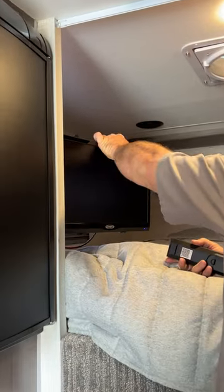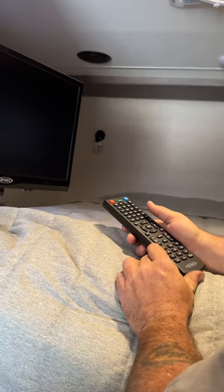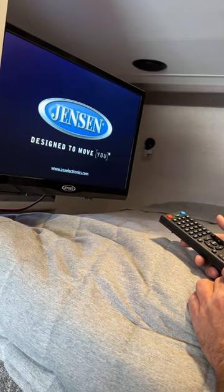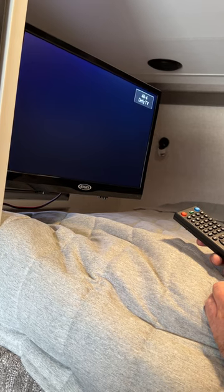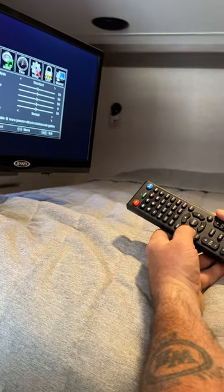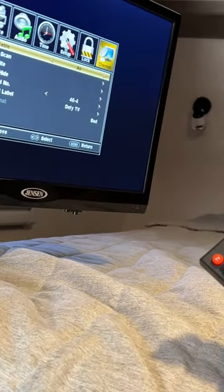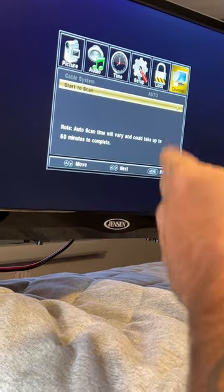I'll come down here and show you our TV. Grab the remote — you've got your options to use the TV or the DVD player. Hit your power button in the center to turn it on. We picked up the local channels close to the St. Louis area. When you get to a new area, you want to scan for channels — push the menu button, push the arrow key back one time, then choose either air or campground cable, go down to auto scan, hit start, and it'll start doing a scan. You will do that anytime you get to a new area, because you're not going to pick up St. Louis stations in Utah or Florida.